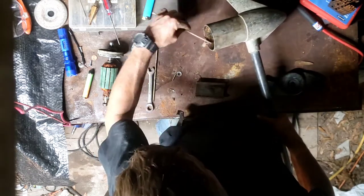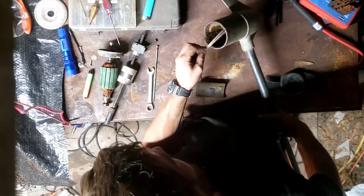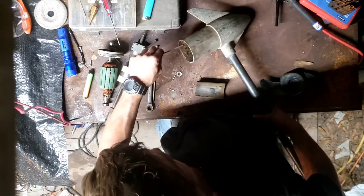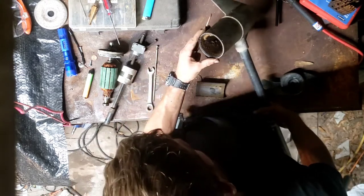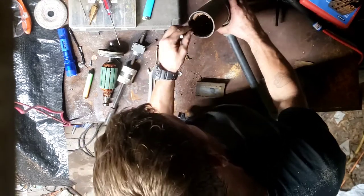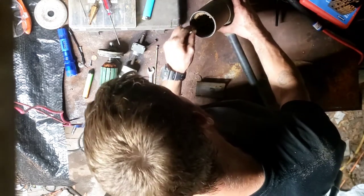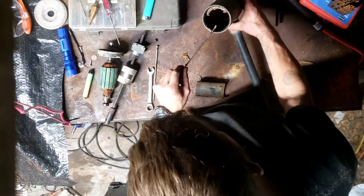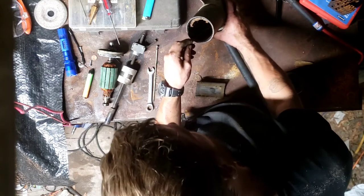There's some crud in here — that's usually what's the problem. The crud gets in here from taking in water. Believe it or not, these things will run for years after taking in water, but eventually it just starts to build up and they'll stop running. There's really some crud in here. Next thing is you've got your brushes in here, and my brushes appear to be completely frozen up.